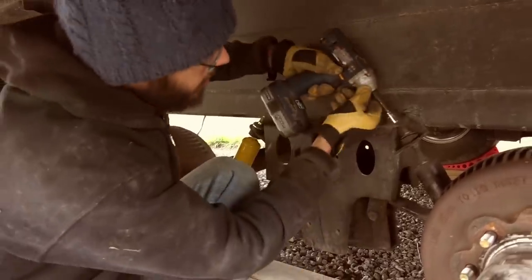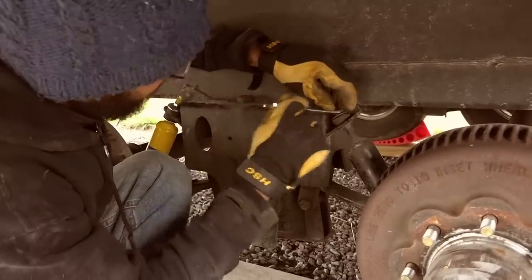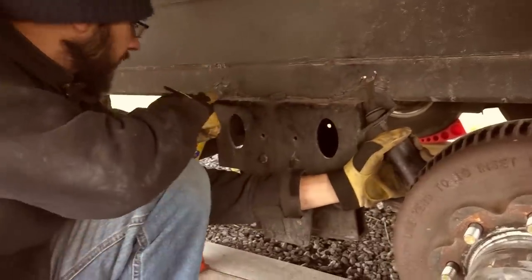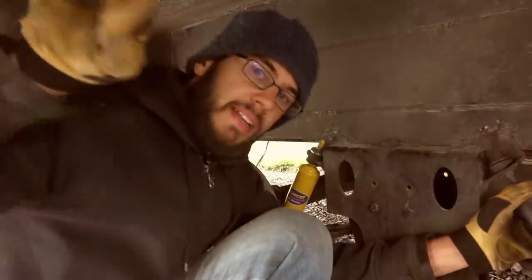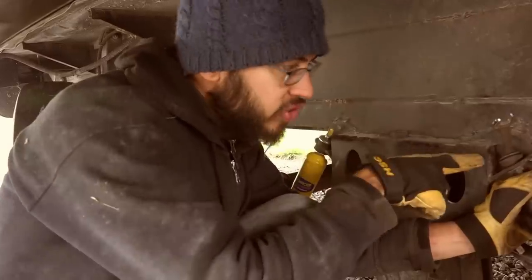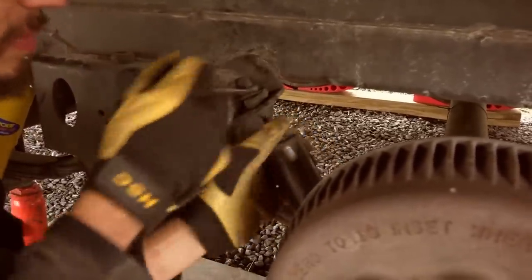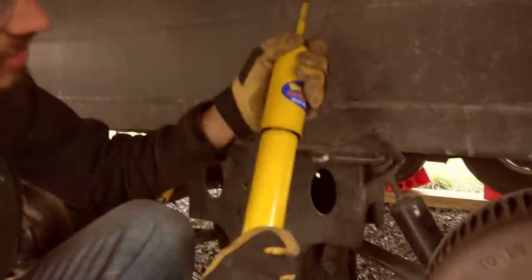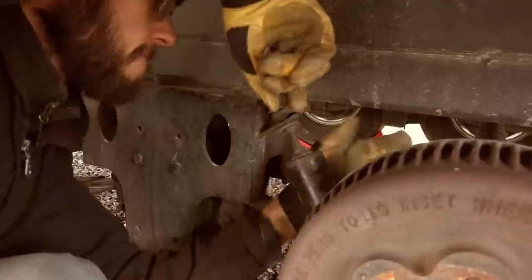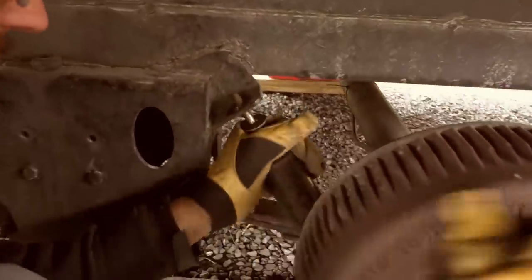So I'll replace this shock with you — it's pretty straightforward. These are our stud type shocks; they just have a stud. Most cars actually have a round bushing that slides onto a post, which can be a little bit easier to install. Motor homes typically use the bushing type, but on a trailer it's usually a stud type shock. So we're just going to go ahead and remove the nut here. You can spin the shock itself — the top and the bottom of the shock rotate separately. In my case, this is a 14 millimeter nut.